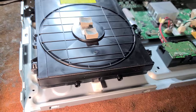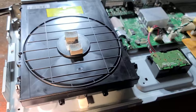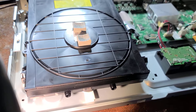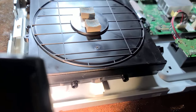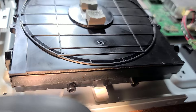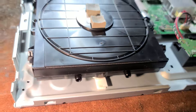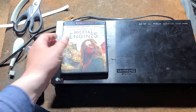Just need to add this update: after spending a bunch of time fiddling with all the little pads, the noise did come back, so where I'd placed them wasn't really the source. After I pulled out all the pads and started with just one, fiddling around with my finger, I found the spot — right under the motor for the tray — and then just a little bit of pressure on top of the center section. The root of all the noise was actually just one point up there.